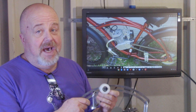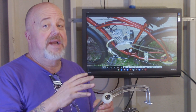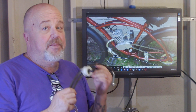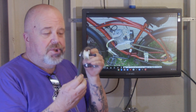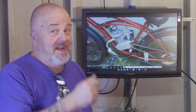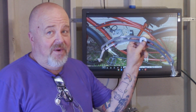This arch-style chain tensioner can save you a lot of grief, particularly if you're not good at setting up a rag joint. A lot of people have problems with the chain coming off the sprocket. Check the link below — I've got a video showing how to properly set up a rag joint. This style of chain tensioner eliminates the chance of the tensioner falling over into the spokes. If that happens at full throttle, it instantly locks up the wheel and you're going to crash and have a very bad time.